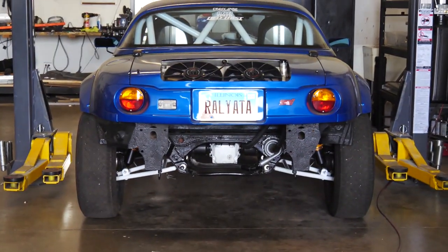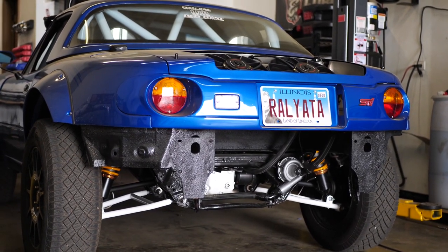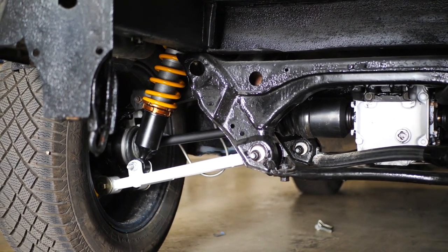That alignment wasn't super accurate - just using basic measurements and hand tools to get it as close as possible. The idea is I got the alignment pretty much good with the heim joints, and then I'll take it to an alignment shop where they can use the alignment bolts and an alignment rack to get it perfect. My DIY alignment is done - camber is significantly better, about zero on each side. The white control arms are perfect, thank you guys for that suggestion - it brings the white into the car more than just the roll cage.